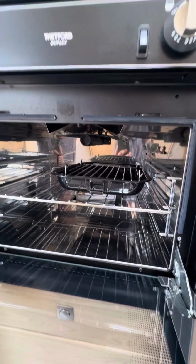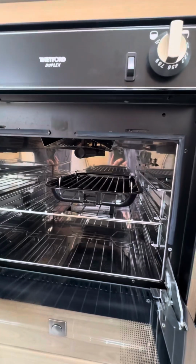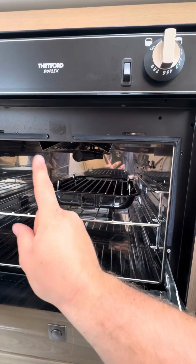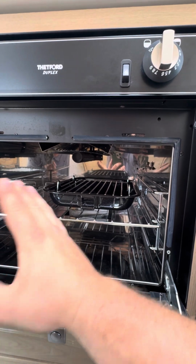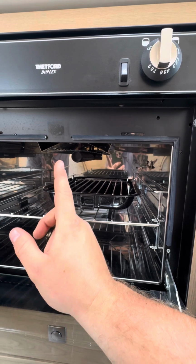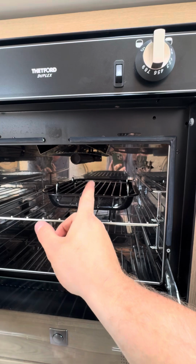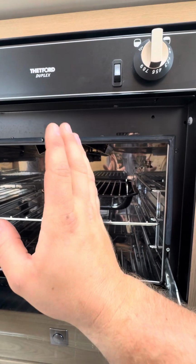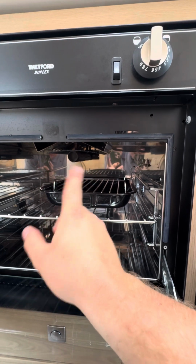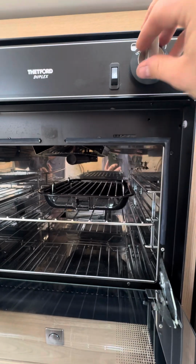With the grills, that's the same with every grill, well, most motorhome grills anyway. When you light it up, because the igniter is on the left hand side of the grill there, it will always light this left hand side up every time, as long as there's gas going to it. So if you light it up on the left hand side and it doesn't light up on the right hand side, all you need to do is give it a little blow in there. What it will do is arc the gap there, bridge the gap, and it will then light up on the other side as well. So if I try it again.